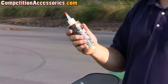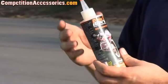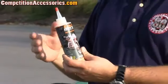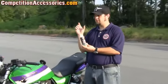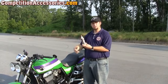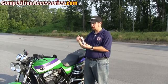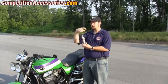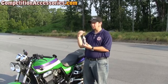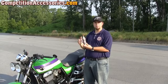This product is a little bit different than some of the other tire sealants out there. It does two things for you. One, it's going to prevent flats from happening if they occur in the center ridge of your tire. This product is going to spread via the centrifugal force of the wheels spinning as you go down the road, spreading around the crown of the tire on the inside. So basically the entire center of your tire tread is going to be protected from flats.